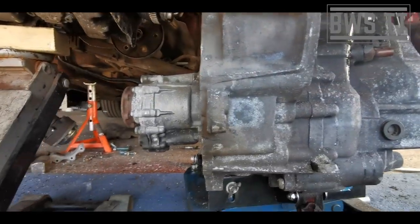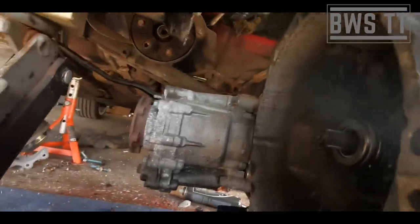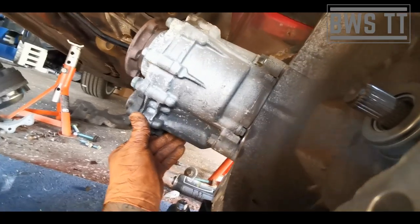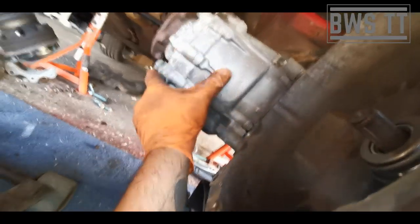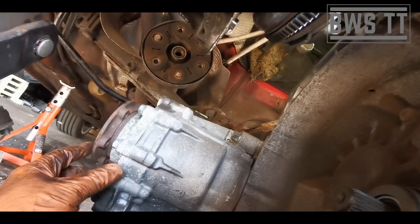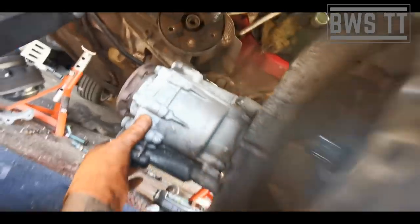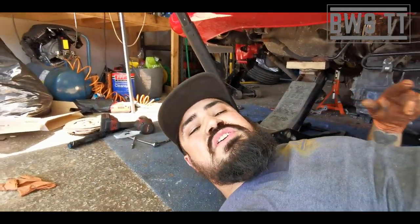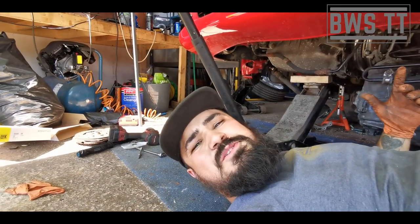Okay, so putting the gearbox back in place. When I jack it up, I tilt it this way, which helps the transfer box go past the part of the block that's the issue up here. And yeah, that's about all the advice I can give at this stage. I'm just going to set the camera up and you can see how it goes back on.